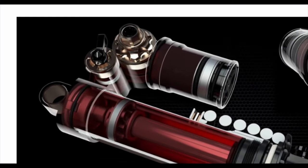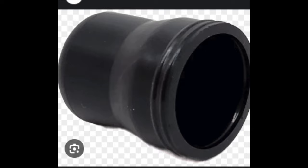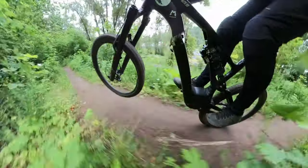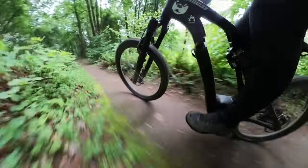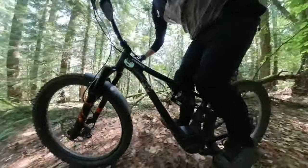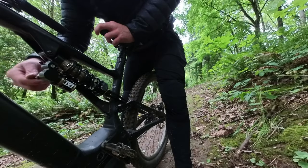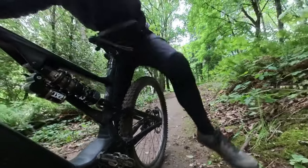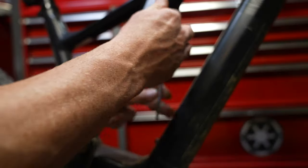The V3 Storia is a dinosaur, and so are IFPs — EXT doesn't make them anymore. You can only get a bladder shock from EXT unless you buy an old or used one like me. After a week on the V3 Storia, I honestly think the IFP style shock rides better at absolute high speeds when you're trying to pin it. The bladder gives you the most insane control over your rear wheel — it will turn you into a trials rider and I definitely prefer the bladder. But for the right price, I'm definitely on the IFP. During the last couple of rides, out of sheer laziness, I discovered the absolute secret for suspension setup success — you have to click this video no matter what shock you ride.